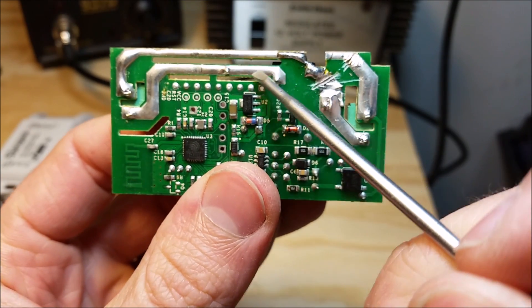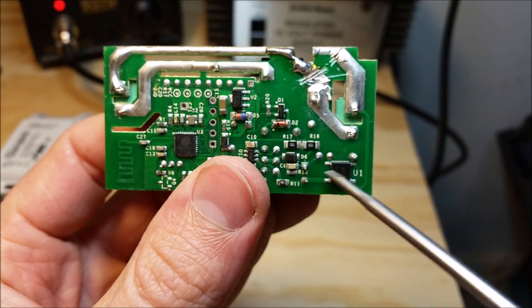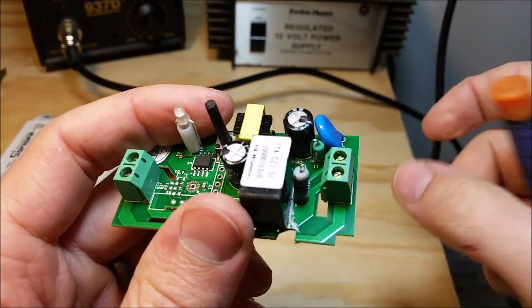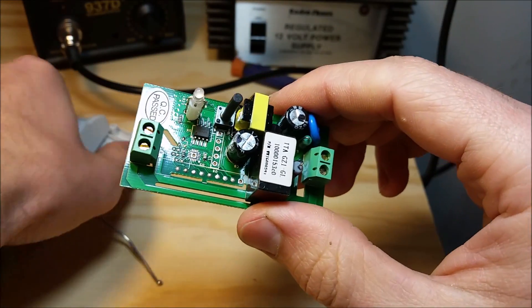This copper used to be here is cut, and this copper is cut. So now this part here is completely isolated from the rest of this. Now everything's done — let me go ahead and put this back into the box and we'll install it in my AC unit.